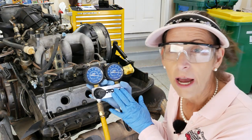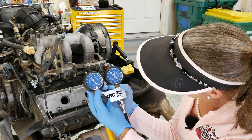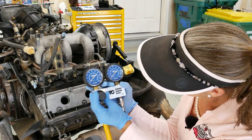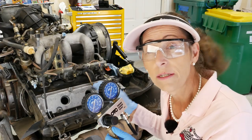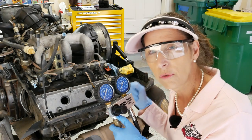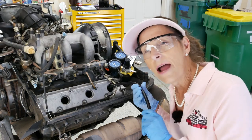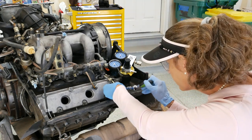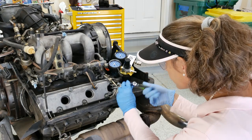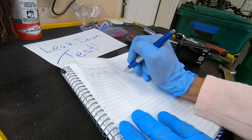We've got our readings — they look really good. We lower the regulator back down to zero, and at this point we're free to move on to the next cylinder. As I take this back out, I'm going to throw the spark plug back in loosely — not tighten it down — just so there's no chance anything falls into the cylinder. I'm always super paranoid about that. Don't forget to jot down your results. In this case, cylinder number one: 90 psi in and 88 psi out.